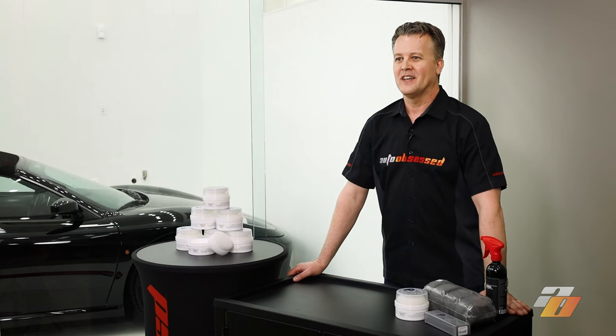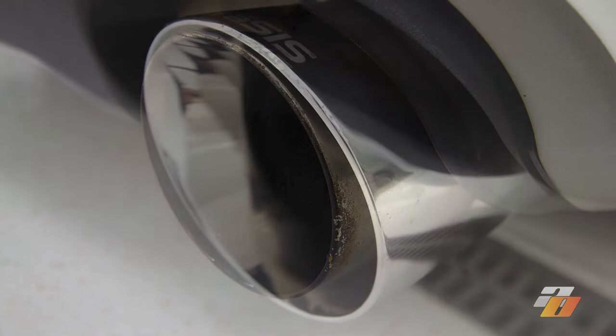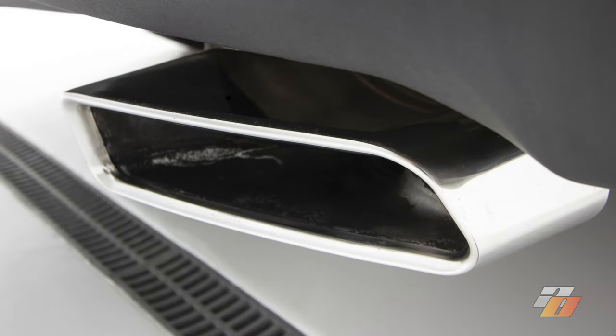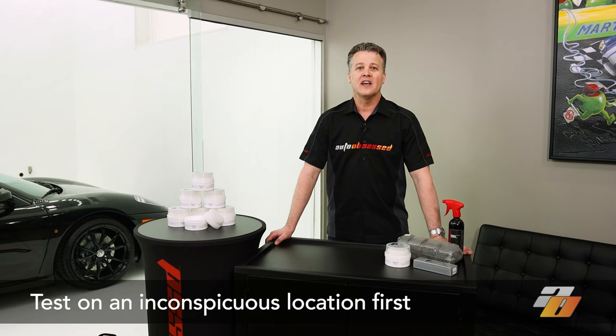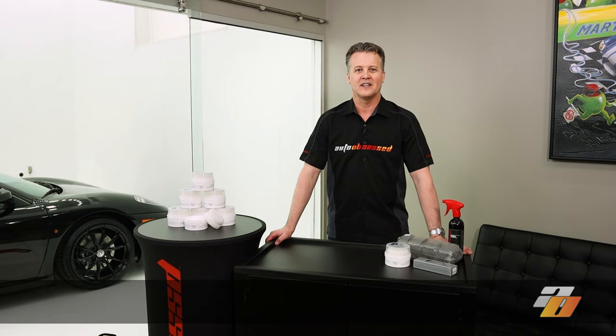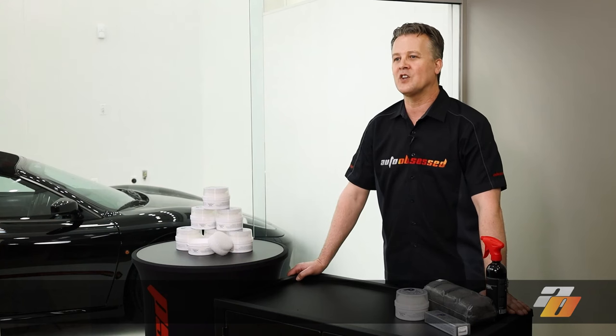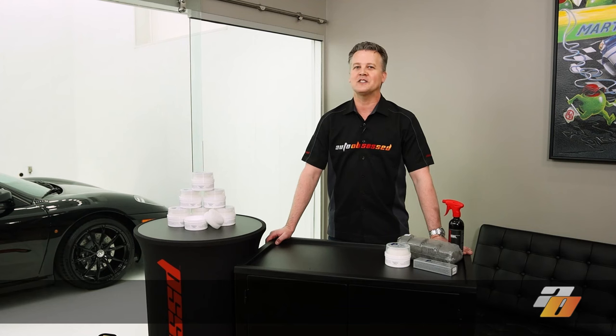Pro tips and tricks. This is good for stainless steel, aluminum, chrome or chrome plated steel exhaust tips. This is not recommended for painted or powder coated materials. There are different materials and cases, so always assess and test for your situation. To get the best results, load up the sponge with lots of polishing soap. The sponge and soap are abrasive, so avoid contacting the paint or surrounding areas. We spray some of the Obsessed Wheel Cleaner on the exhaust tips first — this helps loosen the debris and soot before scrubbing with the polishing soap. If you use the polishing soap on your exhaust tips each time you do a maintenance hand wash, your exhaust tips will look great and make your vehicle look just that much better.